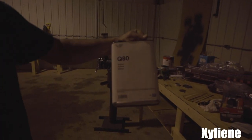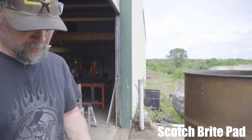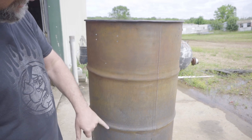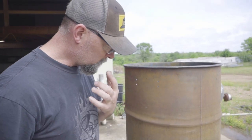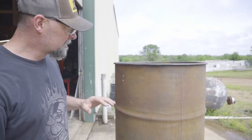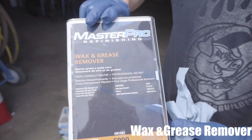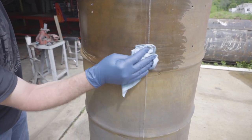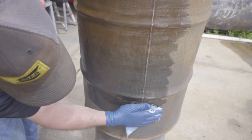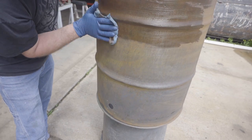Wax and grease remover — Xylene. So first thing we're going to do is scratch this thing up a little bit. I just used good old Scotch-Brite. You can also use like 400 grit sandpaper. The more coarse your thing is, the more of a grit it's going to leave on there. But before we sand, if there's like surface oil and stuff from people's hands or whatever was on this, we're going to wipe over it with that cleaner first. Put on your gloves. A little bit of that — this is wax and grease remover.